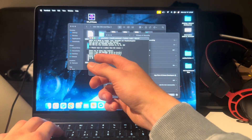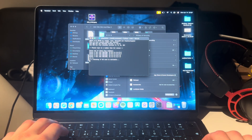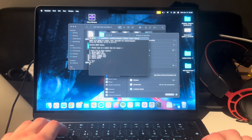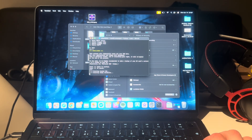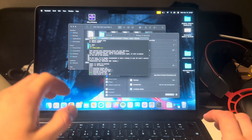When the screen comes up, press 2 to check if the SD card is writable. Then press 1 to create mset9 ID1 and press Enter. Press 1 again to confirm. It's going to make some files. Press Enter when done.